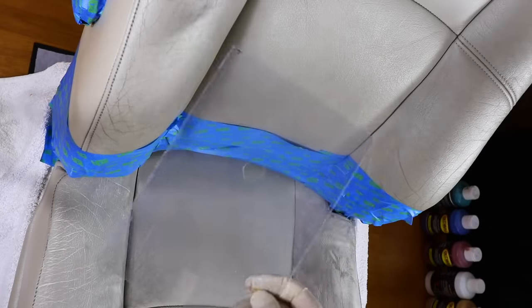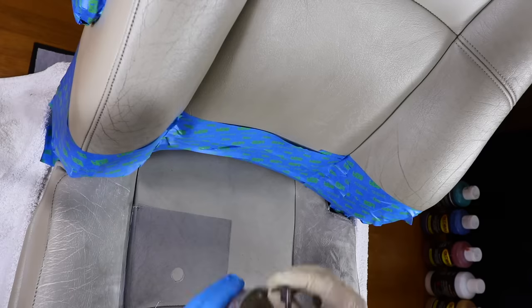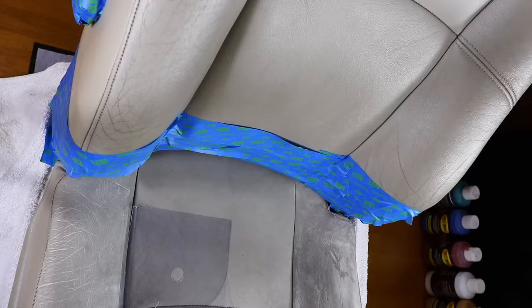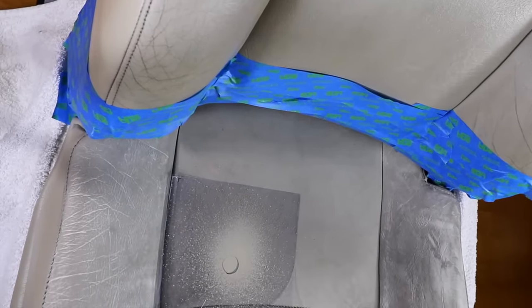Using a clear masking template and a mouthpiece blower, you really need to always do a test spot on the area to assess the accuracy of the color's match. And be sure to let it always dry as it'll slightly change in shade from wet to dry.